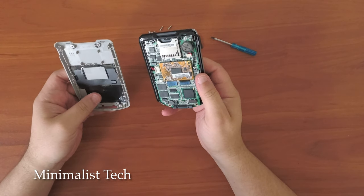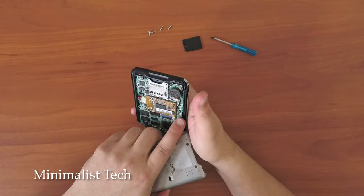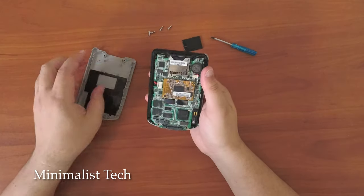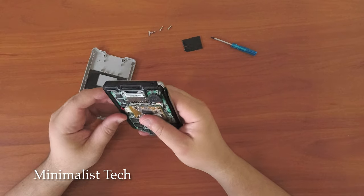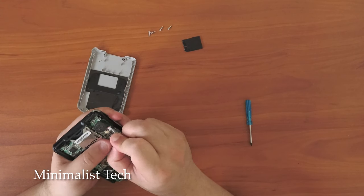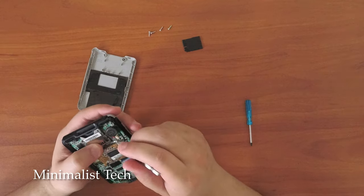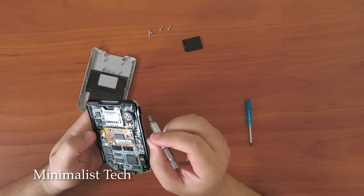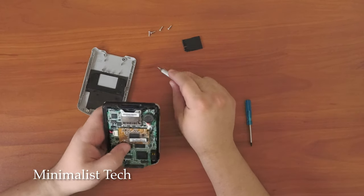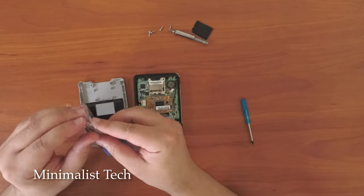Now we have the two sides here. We're going to have the motherboard exposed and some sort of little protective tape on the backside. You can see where the tabs go — there are actually four tabs: the top two tabs and the other two tabs are in the middle. That is the actual speaker, and what's interesting about the speaker is that it is supposedly a stereo speaker. It's a 15mm speaker, but honestly it's not very loud at all compared to a normal cell phone speaker. The piece in the middle is the WiFi card — that yellow piece. I need to grab some extra tools to be able to remove that.